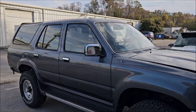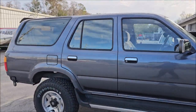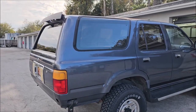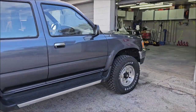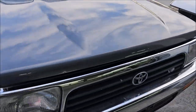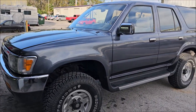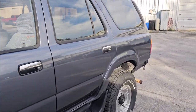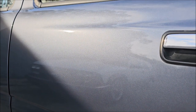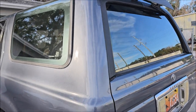It turned out amazing, and as you can see this thing looks great now. I used the factory color — Toyota 179. Some call it dark gray metallic, some call it blue gray metallic. It does have a little bit of blue in it, but that gloss is serious. I put on a high solids clear coat, which means it has a little better gloss than a standard clear coat and will also be a thicker build with fewer coats. You can see that in the sun — I laid down the metallic really nice and even, did a nice drop coat at the end. Super happy with how it looks.